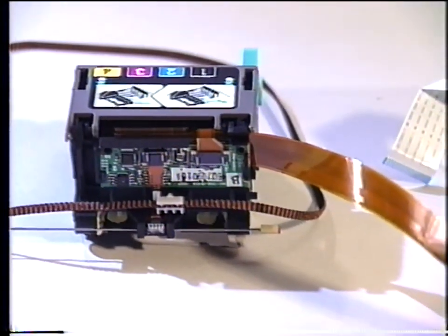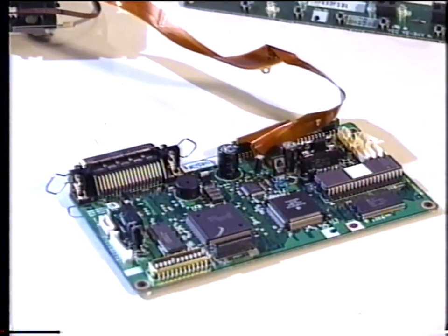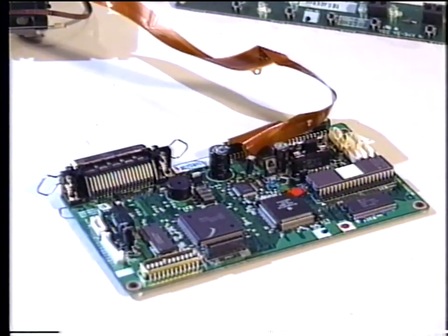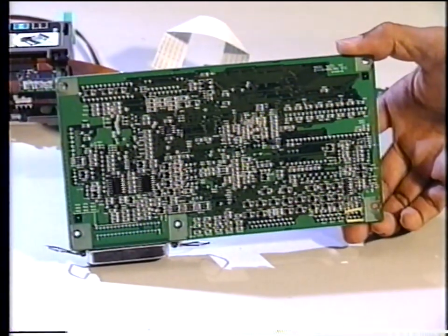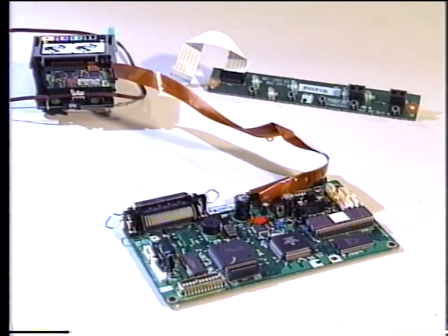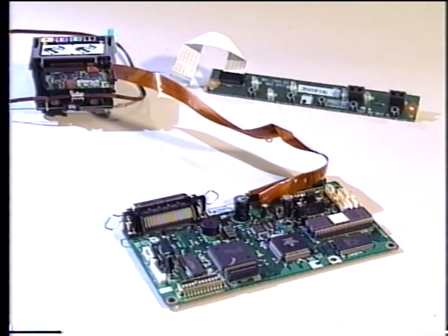The carriage home position sensor is located here. When the carriage reaches the home position, the carriage arm actuates the sensor. Carriage information is sent to the control board through the ribbon cable. The control board processes all printer-related functions. It contains the parallel interface, the printer controller IC, which translates information from the computer to the printer's microprocessor. This is the microprocessor unit, the dip switches, DRAM, CG-ROM, which contains the printer's control program and font information. A 1K-bit double EEPROM contains electronically registered data and the linear circuit control. The linear circuit control IC contains functions such as automatic rank correction, head rank detection, and linear encoder adjustments. The linear encoder is located behind the carriage shaft.